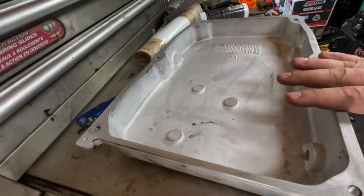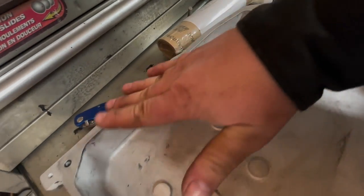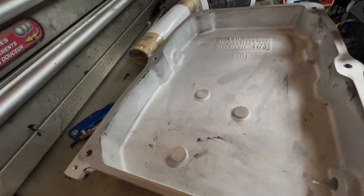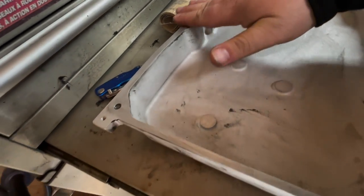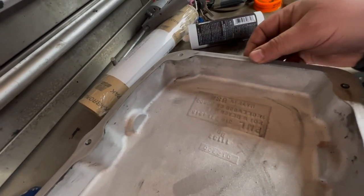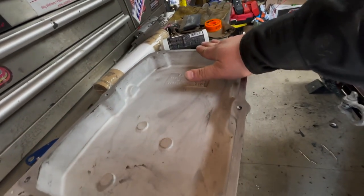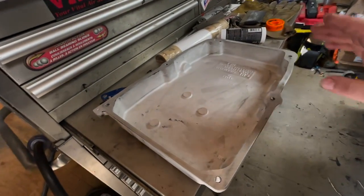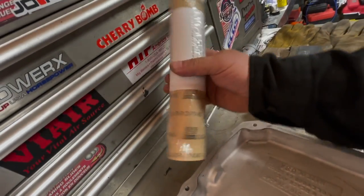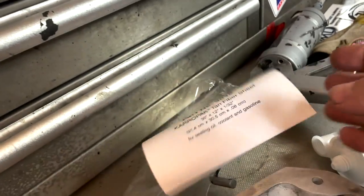It fits and I can slide underneath now, but there's still one dilemma - when I slide it underneath I could actually still roll this gasket back. So what I'm going to do is make another gasket and then silicone it down. I'll put it flat down on a table, put a weight on it, and that's going to help compress it and kind of seal it so then when I put it underneath it should stay and not have any issues rolling. New gasket material says it's for sealing oil, coolant, and gasoline.